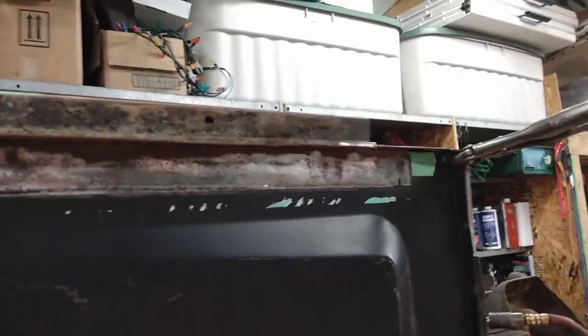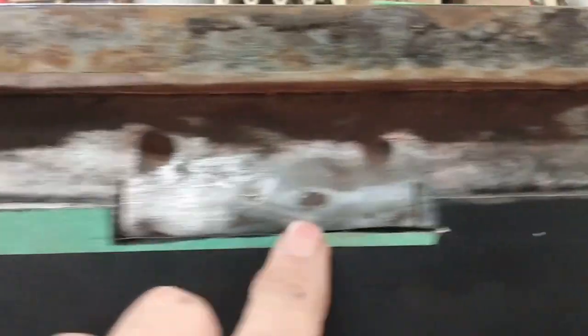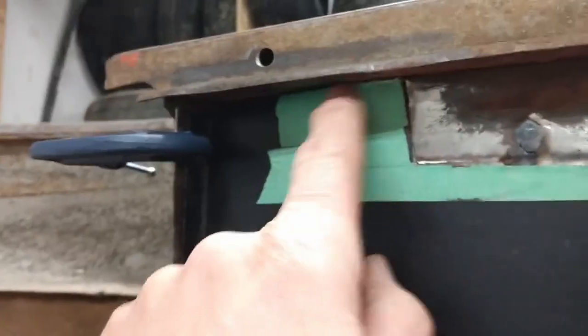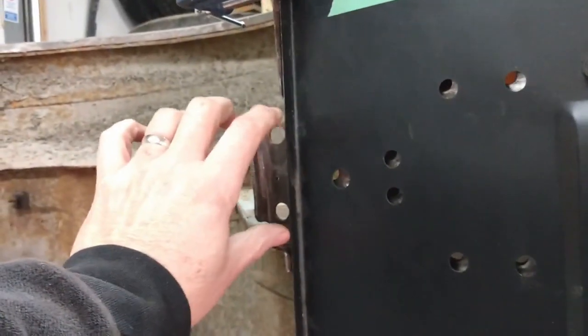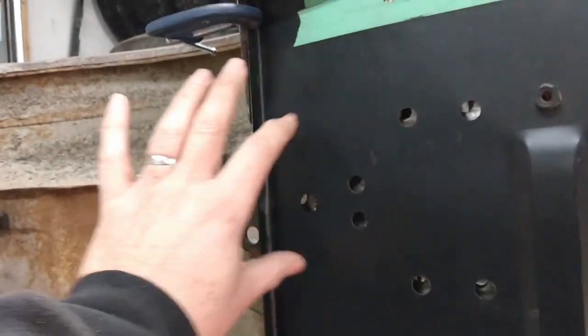Here's the first fit of the panel. The fit over there is good. I've got a nice butt fit here. Once this gets pushed into place, that'll just stitch weld along there, butt weld it there, and then we'll stitch it along here, butt welds there, and weld up in there, and then this will end up getting plug welds through there. This little bit here will get cut out, but I'll do that later. And then the spring plate mounts in here.